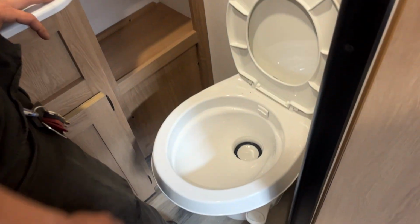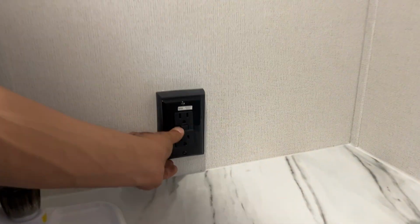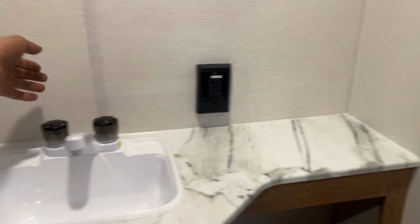Into the bathroom. Come in here, light button, it's just on its own center push button there. Get your toilet there, just flips on open, you get your flusher on the right side, some storage right beside it. GFI protected outlet on the wall there, test on the left, reset in the center, so if you ever have outlets that don't work, it's the first thing you should check.